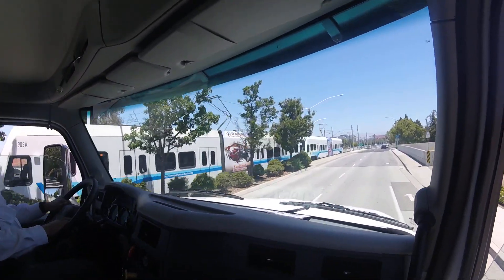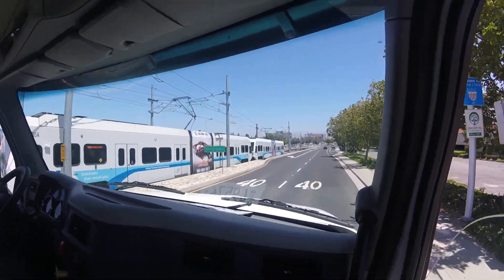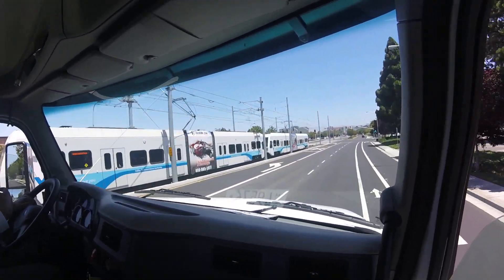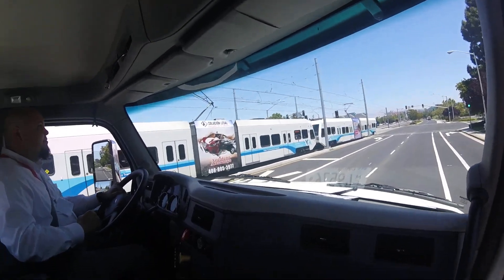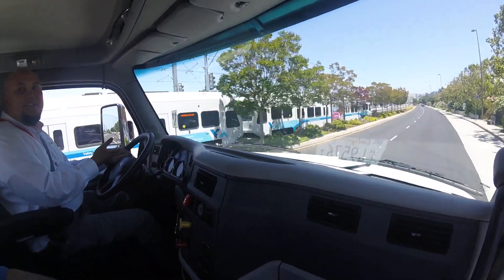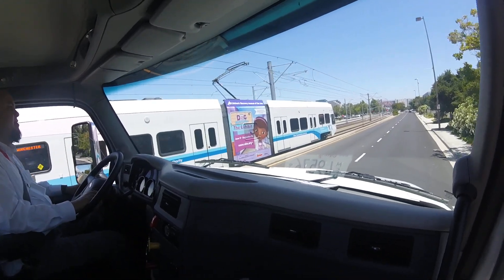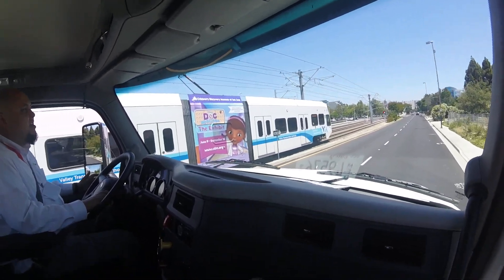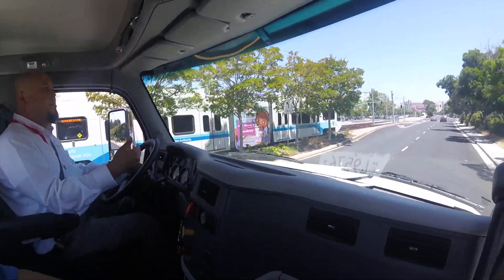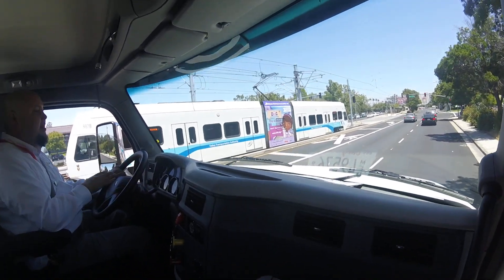We send the message to the instrument cluster. When this thing reads empty, there is actually some more energy left in those batteries — that's just to keep the longevity of the vehicle. But if a driver runs out of energy, it's just like running out of diesel in a diesel truck: your vehicle will stop. A technician can do a temporary override to get the vehicle off the road or move it to a charging station, but the driver has no control once he's empty — he's empty.